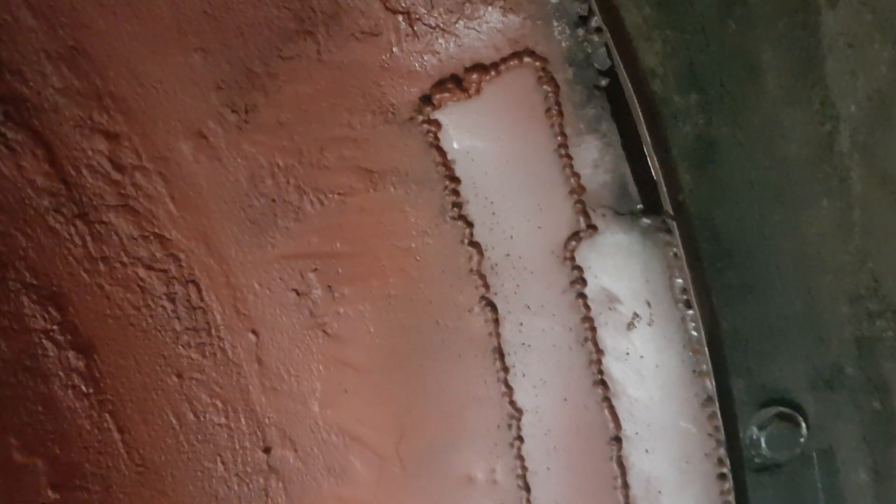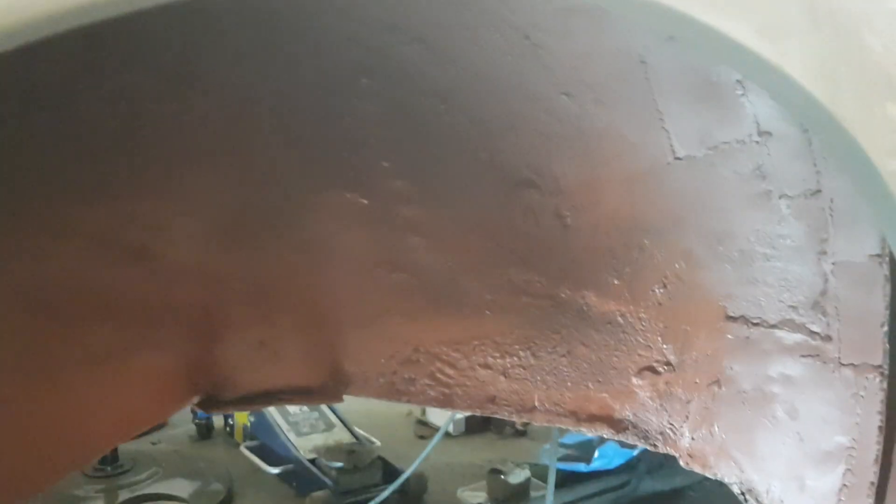As you can see I've had to patch it. I'm unsure what you have to do with these patches — whether to grind them flush or whether to just leave them there and put some seam sealer on. I've managed to come all the way around and I've just put some red lead on, just because it was there really.